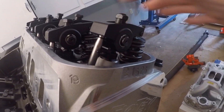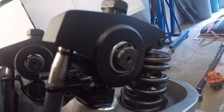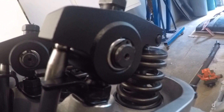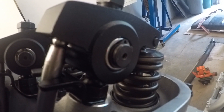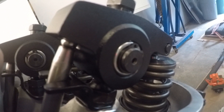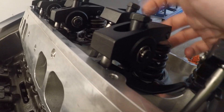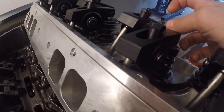Here's our exhaust valve for cylinder number one. I'm going to slowly crank the engine over and try to show you guys this rocker just starting to go down. You see that — just that little movement? Now that the exhaust just started to head down on its stroke, we now know that our intake rocker and lifter — really it's the lifter wheel, but it translates up here — we know that it is on the base circle of the cam, so we can adjust this now.